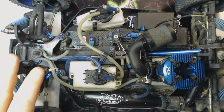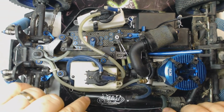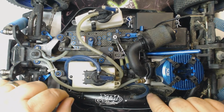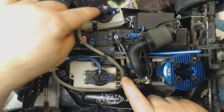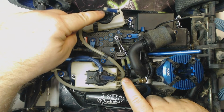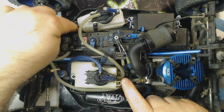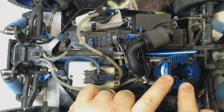So essentially you probably have the idea already, but I'm going to go over the entire thing now because I only went over half of it the first time. So you've got your back pressure coming out of your pipe, pressurizing the first tank, pushing fuel from the first tank to the second tank, which in turn causes the second tank to be pressurized, and then the fuel will travel from the second tank through the fuel line and eventually to the motor.